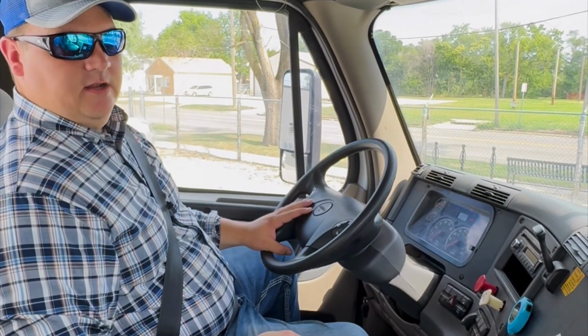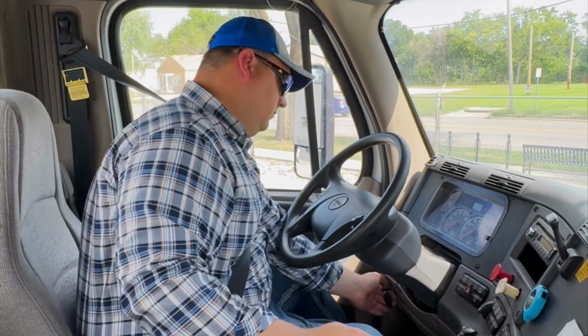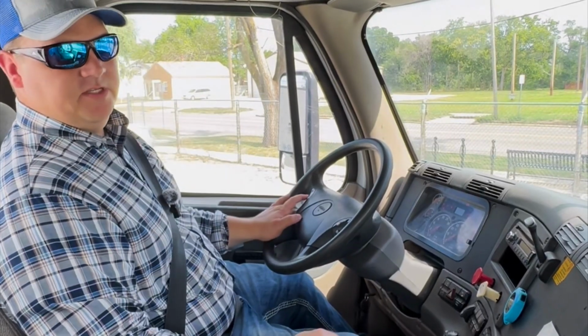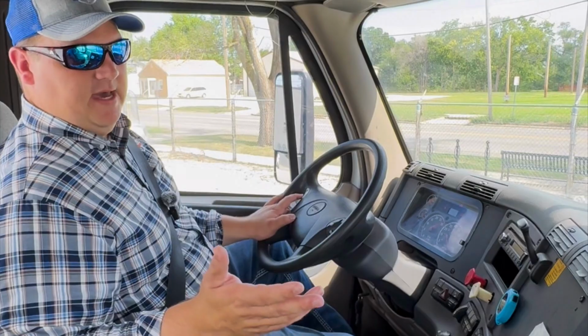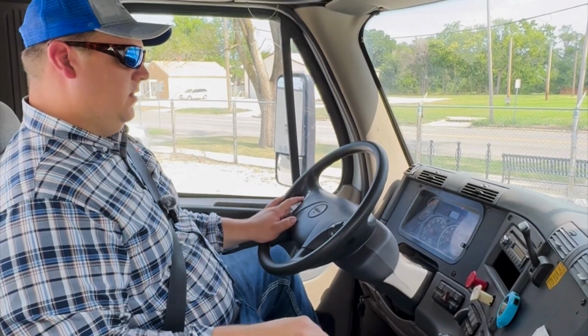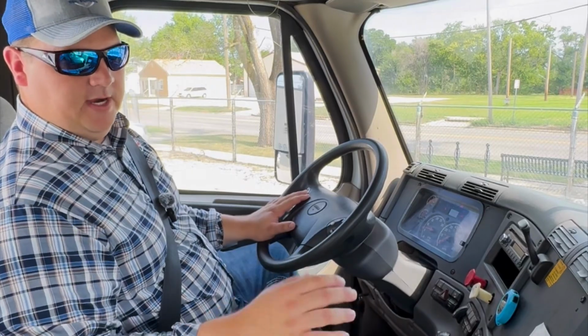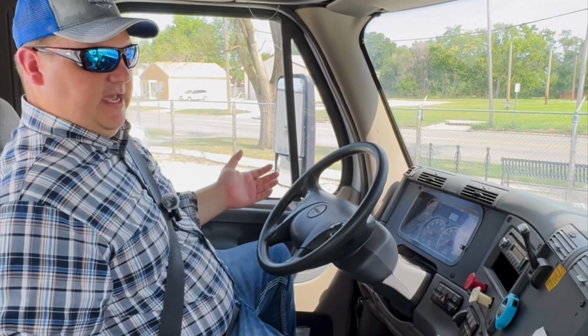Now that we've completed our air brake test, we will start the vehicle to build the air. Performed a safe start, clutch in and in neutral. Again, if you were in an automatic, it would be chocks in your wheels, which at this point you could go remove since we're through the air brake test. As our air builds, we're going to go through our in-cab inspection.